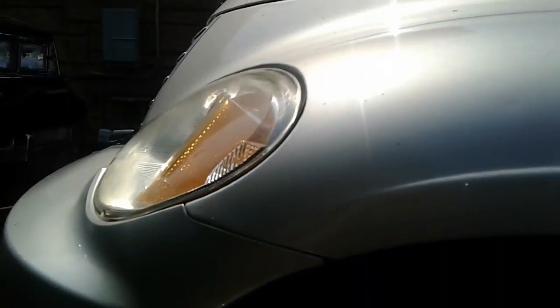I'm here today with the headlight replacement on a Chrysler PT Cruiser. As you can see, there's a nice trap door in the inner fender. What you're going to need is a flathead screwdriver to get in there and help pry it out. It just slides out of those tabs there. Don't mind the wire mess — that's some aftermarket nonsense I still have to finish taking out.